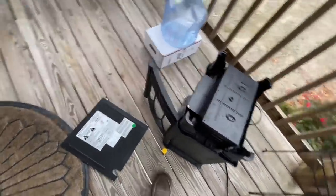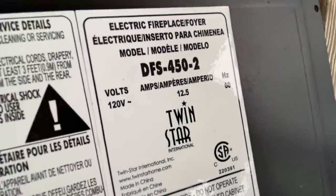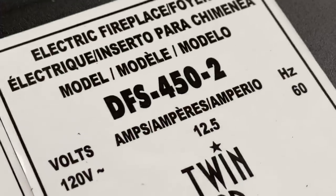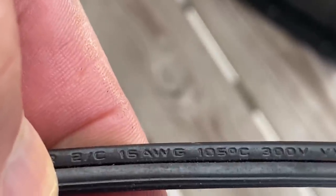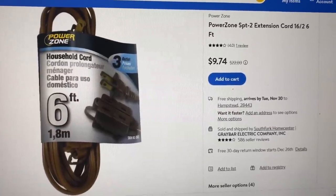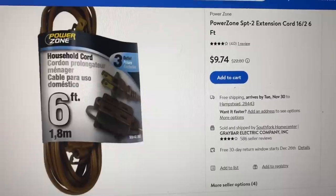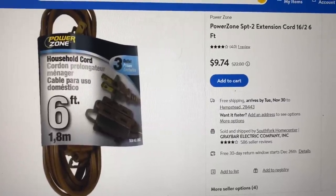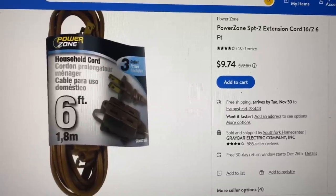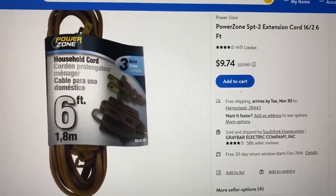Now we know: the amperage is 12.5. I looked it up and for that amperage this should be a 12 or 14 gauge cord, but I found it's only 16 gauge. Here's an example — this extension cord is 16 gauge, two-wire. As a reminder, you never want to use a lightweight household cord for something that draws a lot of amps. It's just very dangerous.